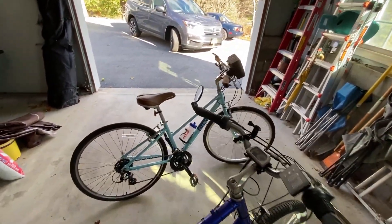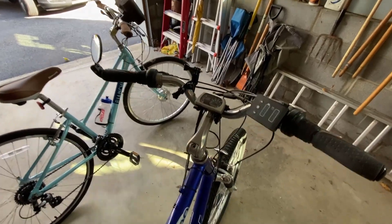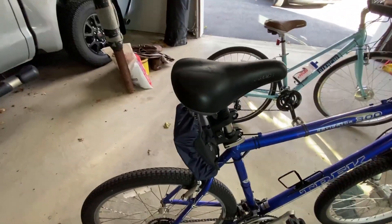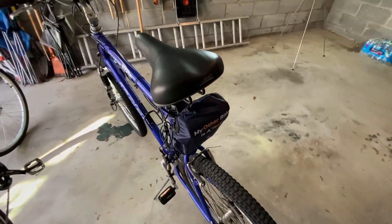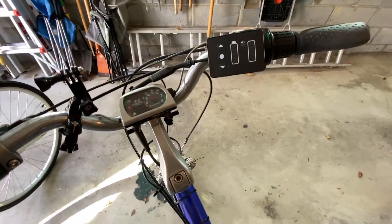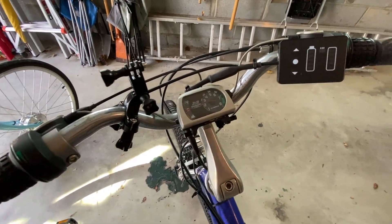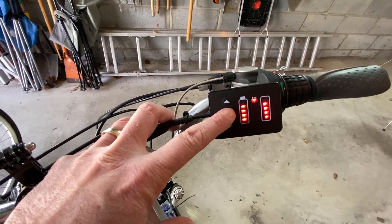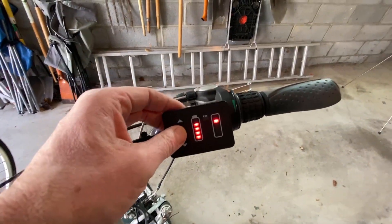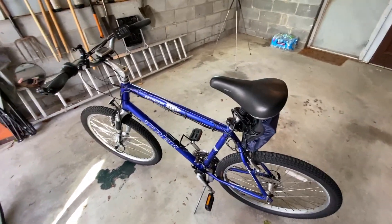What are the differences between my wife's bike, generation 1, and my bike, generation 2? Well, there's no more battery on my handlebars — I've mounted the battery back behind the seat. I've got a very uncluttered and unweighted handlebar. I've moved my gear shift indicator back where it belongs, I can now put a headlight on there, and best of all, my controls are now located where I can reach them without removing my hands from the handlebars. Let's take a look at what it takes to do this.